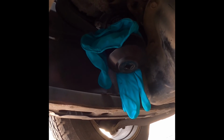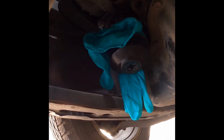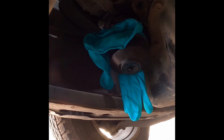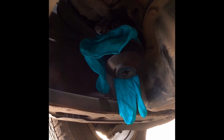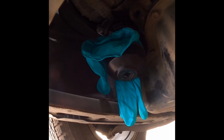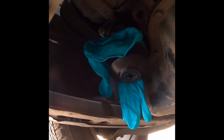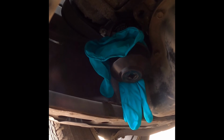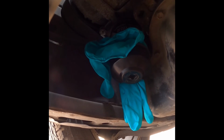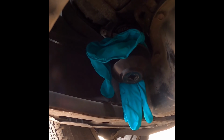Okay, so the cup wrench didn't grip. I went down the road to try and get one of those 3-legged ones that gets tighter as they go. I haven't got any. Thanks to COVID-19, the queue for Halfords was around the car park, so I've improvised and that's actually worked. I'm just putting a bit of something that grips in between the cup and the filter, and the filter's now turning, so that's loosened off, so that's good.